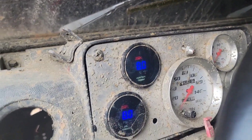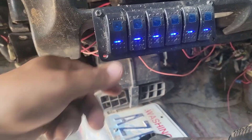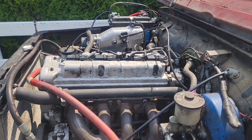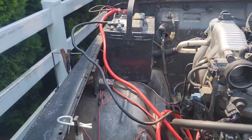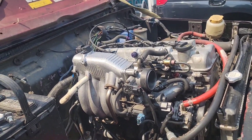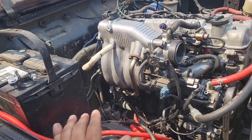The dash stuff comes on. In theory this button here is what they said. It made some noise. That is a starter issue — it sounds like that starter is shooting right past the flywheel. There's a difference between the starters you need to make this work with the two-liter. I guess one's an eight-tooth, one's a nine-tooth, something like that. That starter sure sounds like it's just shooting right past the flywheel.